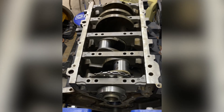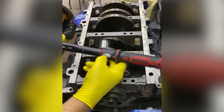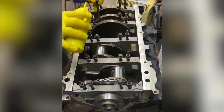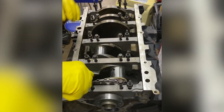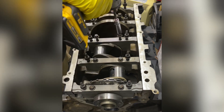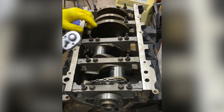Our first round is at 20 Newton meters or 15 foot-pounds. My torque wrench has both — Newton meters on top and foot-pounds on the bottom. I'll go ahead and run these in with my impact driver first, then torque them all at 15 foot-pounds.